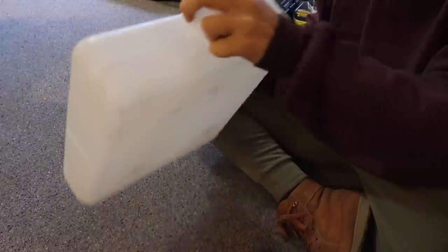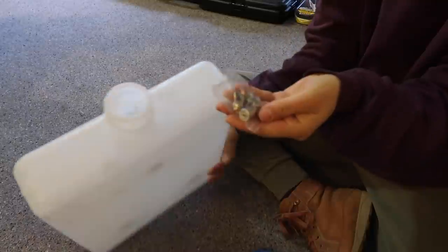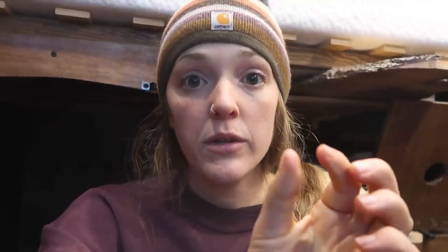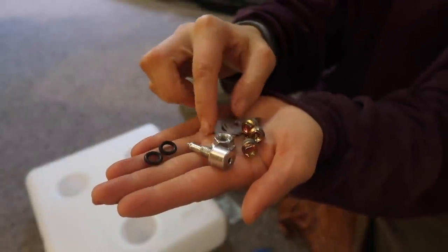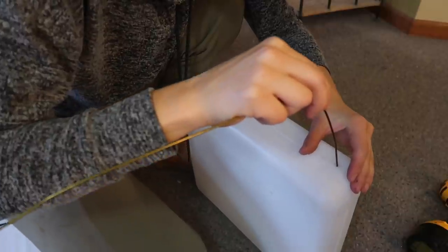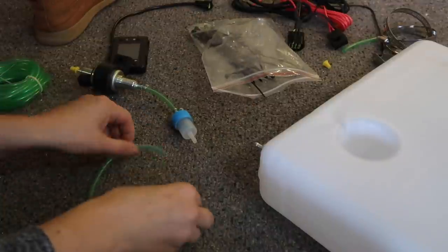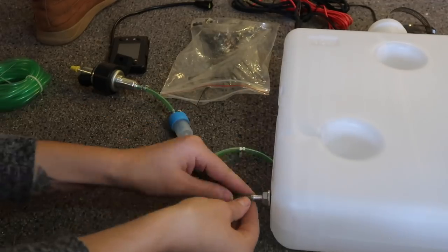The next thing I did was prepare my diesel reservoir. When you get your diesel heater, it comes with all the parts needed for using the little diesel reservoir, or if you have a diesel tank it comes with parts to tap into it. The first thing you really want to do is plan where you want your diesel to come out — that part connects to your fuel filter, the little thing that looks like a weird acorn. Once you know where your fuel line will come out, you drill a hole there. The little nipple they give you comes with two washers — one on the inside of your fuel tank, one on the outside. I used a hanger to feed it through and tightened it down snug, not too tight so you don't stress the plastic. From there I connected my fuel line. At this point I had my 10-liter diesel fuel tank connected to my filter, which was then connected to my fuel pump, all with the green fuel line provided.